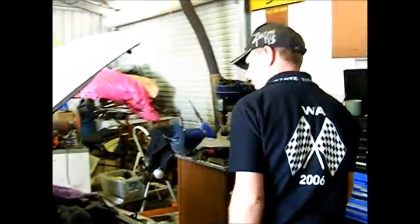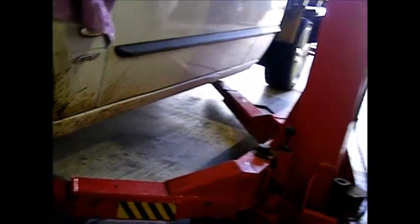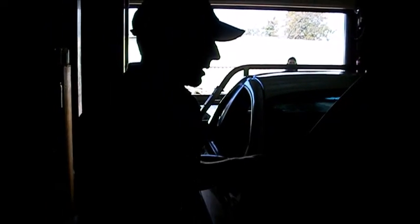And when you put a car on a hoist, always have it in neutral with the handbrake off. So when you go to work on things, everything's free and you can turn wheels and drive shafts and all that sort of thing. And you always have to lift the vehicle by the chassis. Also, when you disconnect the battery, you can hook a 12 volt or a 9 volt thing in a cigarette lighter, so then it will remember all your codes, so it doesn't reset your radio and all that sort of stuff. But we didn't worry about that because it's a pretty simple vehicle.